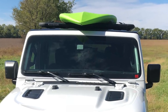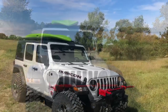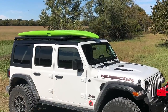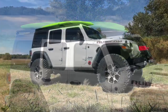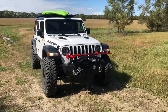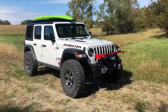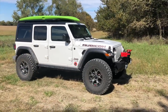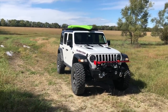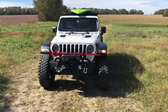Let's talk some numbers. How much height does this add to the Jeep? It only adds just under two and a half inches — it advertises 2.25 inches — and that's without rails or anything else added. I've just got the flat rack here, which is great. For weight capacity, the dynamic load rating is 300 pounds, so driving down the road you can carry 300 pounds. Static, it can hold 900 pounds. Even the largest rooftop tent on the market with three or four people in it isn't going to hit 900 pounds, so it will hold plenty of weight.